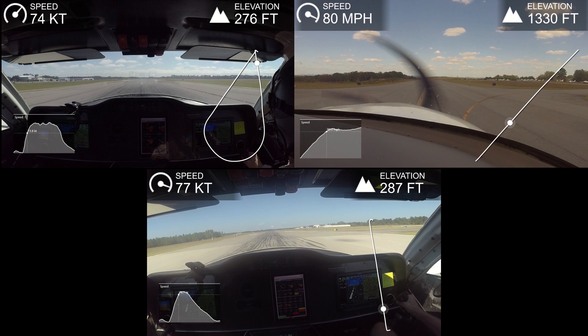Continuing on to where the Cirrus actually rotates and gets airborne — the Raptor top left is about 84 miles per hour and bottom center is about 88.5 miles per hour, so definitely beating the Cirrus on performance. The Raptor has to rotate later because it doesn't have as much lift without flaps. So I'm not worried about power in this aircraft. I've addressed power, I'm addressing cooling, and I'm addressing the turbulence under the wing by covering those wheel wells.